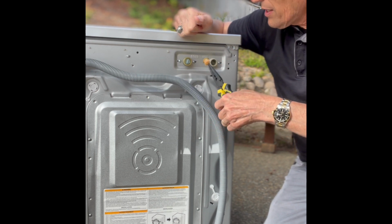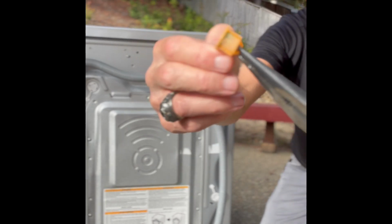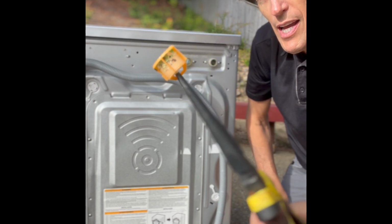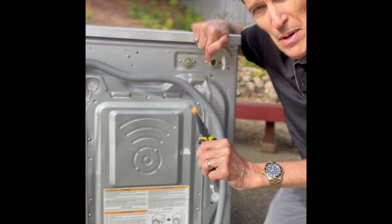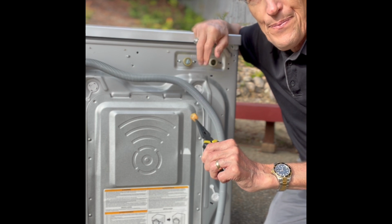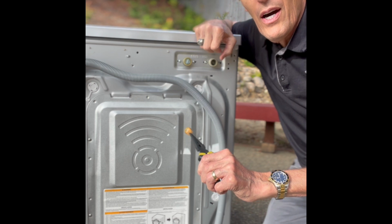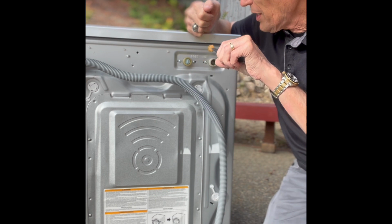The hot side in this machine actually has a little bit more debris, more stuff. And again, you just rub that stuff off under the sink, or you can use an old toothbrush, and then once it's clean, you can put it back in. Now, if you have stuff that's kind of back in there in the metal screen, you may want to use a squirt bottle and squirt in some water, that would be great, and that'll flush it out. You could use canned air too to just get that stuff out. Once you're all done, you can put that back in.